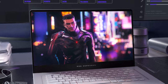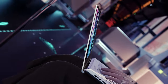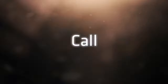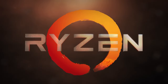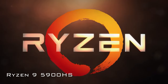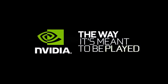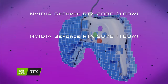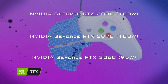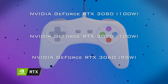And the result of this is the ROG Zephyrus G15 GA503, which aims to completely revamp our views on the family of laptops. For starters, it now comes with a Zen 3 portfolio of processors, maxing out with the Ryzen 9 5900HS. Also, on the graphics side, you have the latest and greatest from Nvidia, in the form of 3 Ampere GPUs. The top option here is the RTX 3080 that has 8GB of GDDR6 memory and a TGP of 100W.